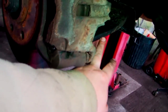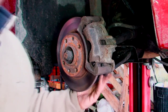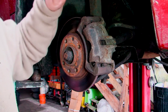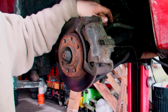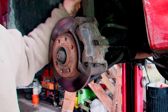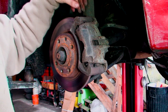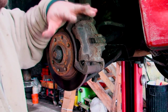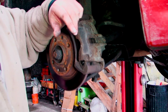You can just see the top of the wishbone there. But if you take the bottom wishbone off, the problem is you have to disconnect the steering arm, you have to disconnect the brakes, you have to disconnect a lot more stuff. Whereas if you just take off the bolt from the actual shock, you only have to disconnect the drop link. But you have to basically wedge the whole hub and everything down. They both are a nightmare on this particular car. Some cars just have two bolts that go through the shocks — it flips off. They're easy. These aren't.